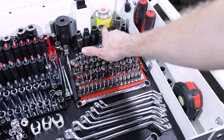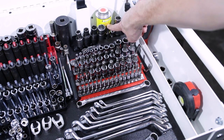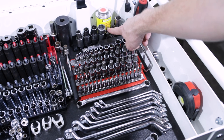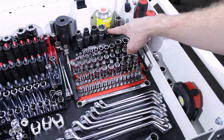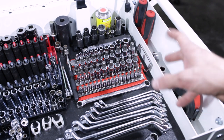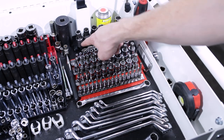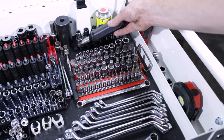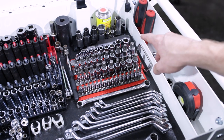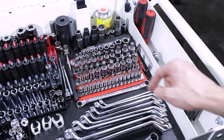I think it's 12, 12, 14, 18 — and I think it's 17 back here that's broken waiting for warranty — so three-eighths impact sockets. We've got the Torx Plus or tamper-proof Torx Plus — it's the five-star squared-off-ended Torx instead of being pointed. It's the fastener for single overhead cam Subarus like the EJ253 for the bolts that hold on the cam cap. And we've got two Phillips bits for the old impact driver — good for knocking out the screws on the wrist pin cover access and for getting the screws out of the oil air separator plate that haven't gone to the new steel plate with the four mil hex button head screws.